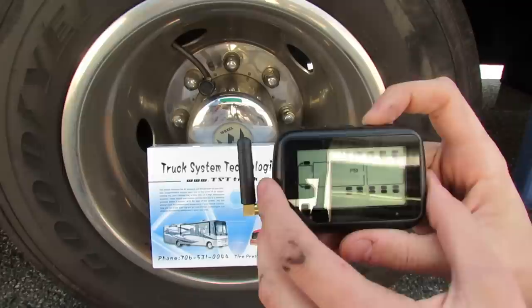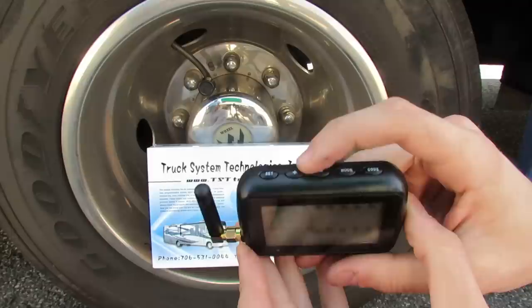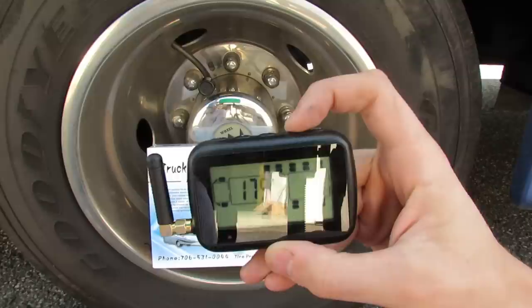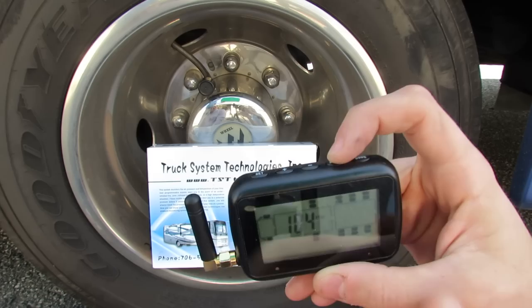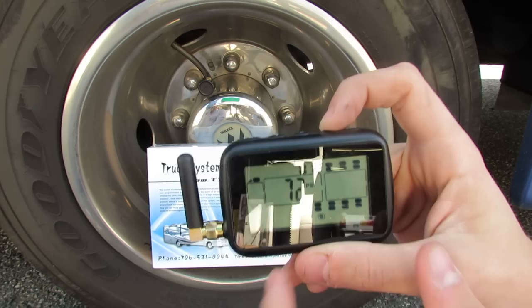When you come to the screen, you'll see PSI flashing. Press mode to go past this. You'll come up to the Fahrenheit sign — some of you may have Celsius on your screen. To change that, simply press the plus button to switch to Fahrenheit. Press mode and you'll go on to your front two tires. You'll see a high pressure tire with 175 PSI; it goes up to 196 and as low as zero, so set yours accordingly. Press mode to go to your low pressure setting and change that using the plus and minus buttons. For our system running 80 PSI, our high pressure is 104 PSI and our low pressure is 72 PSI. Use the plus and minus buttons to scroll through all the PSI values.